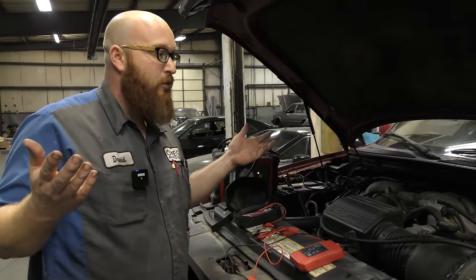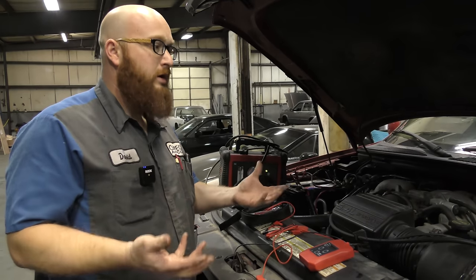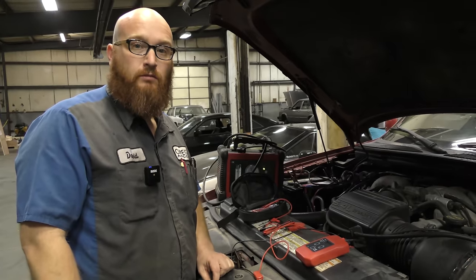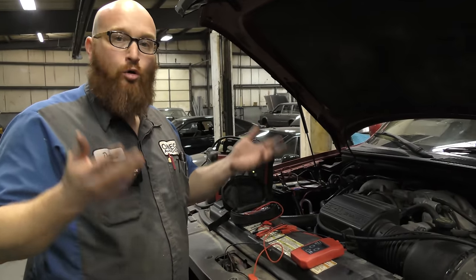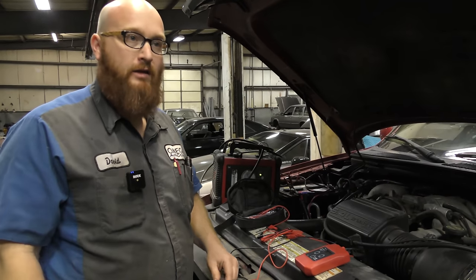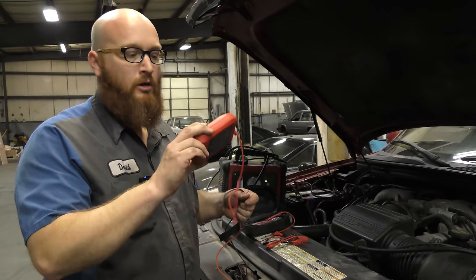What could it be? There are like 40, 50, 60 different circuits on a car. Could it be a bad alternator? Could it be your radio, your CD changer not shutting off? Could it be a module in the car that's not shutting off? In today's cars with so many different computers, electronics, and modules, you could literally spend days finding it. I've had people bring their vehicles to my shop with the same scenario — they say, Car Wizard, I've spent all week trying to find this and I just can't do it. This little guy right here can turn five days' worth of tracking down into ten minutes.